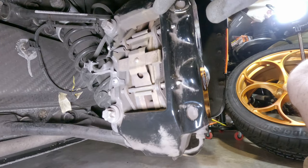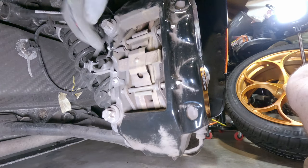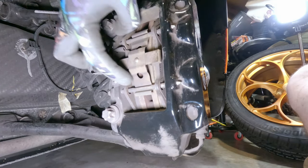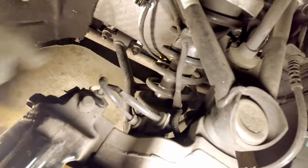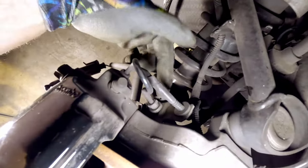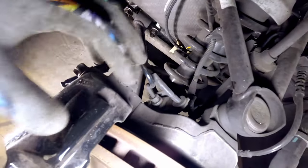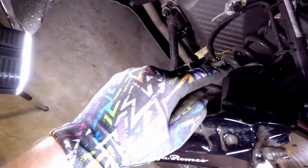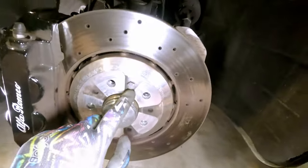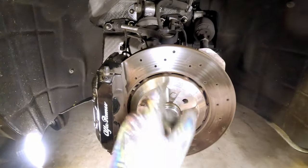Alfa actually makes it really easy to swap the brake pads out whenever it's time. You have to disconnect the little wear sensor, then these pins just push out and the brake pads slide out. When it comes time to replace the rotors, that's not too hard either. You have to pop this clip off the hard line that connects into the caliper, then there's a little bolt that lets you take that bracket off, freeing up the caliper to swing out of the way. Then it's just these two e-torx bolts, and the rotor has just one bolt holding it on. I'll do that when I get back, so look forward to that video.